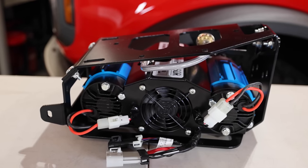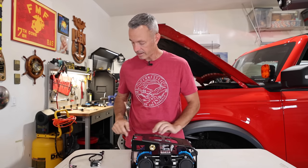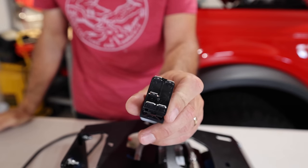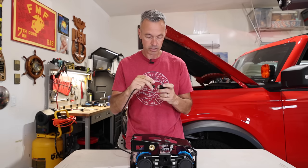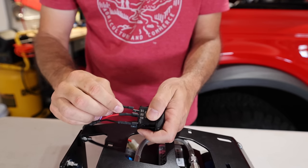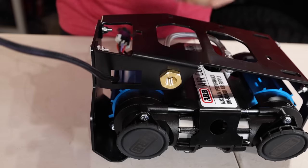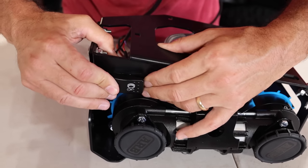That is a nice solid, stout package — a good casing for the compressor. Now when we pull the PCM out of the Bronco, it's actually going to mount right here on top. But first the directions say we need to wire up the switch. They gave us this nice wire loom with three wires on the back of the switch. There's one side with two tabs and one side with three tabs — we're going to plug into the side with three tabs. It's black, red, and purple, and those just plug right in. Super easy. They've created this perfect little block on the bracket where the switch is going to go, so we feed the wire through and push it in, and it snaps right into place.